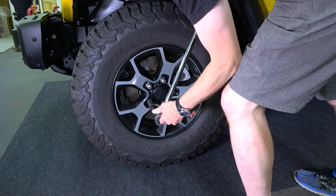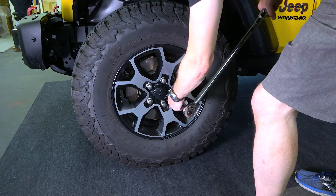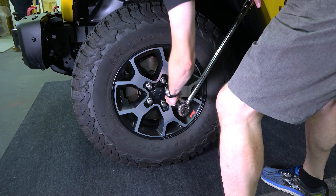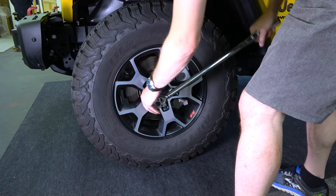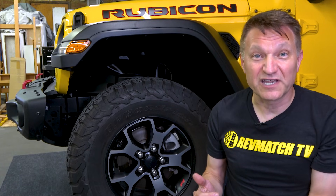There are three things to mention. First, when you're first getting the bolts on, do them by hand — don't use any tools. Use your fingers so you can feel the threads; you don't want to strip them. Second, I'm going to show you how to maintain your torque wrench later in this video — keep watching. Third, you can pre-tighten bolts with an electric impact, but I wouldn't recommend it until you're experienced. Getting the right torque is important: if you under-tighten, wheels can literally fall off on the freeway; if you over-tighten, they might get stuck and you'll have trouble removing them if you get a flat.